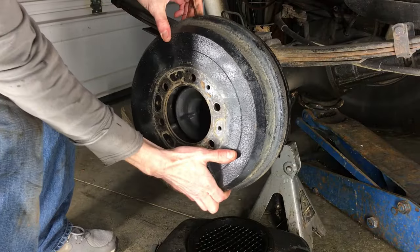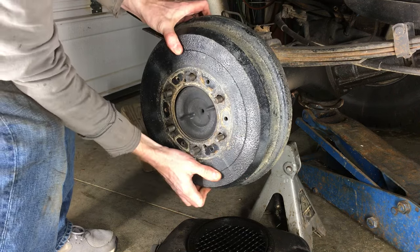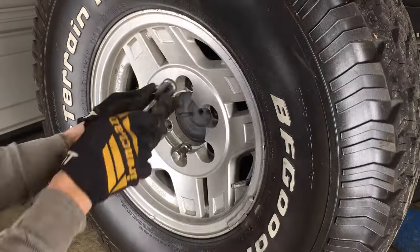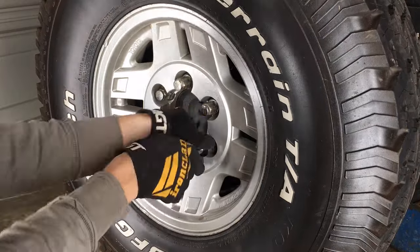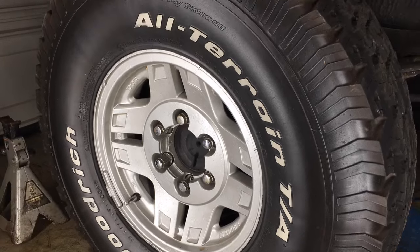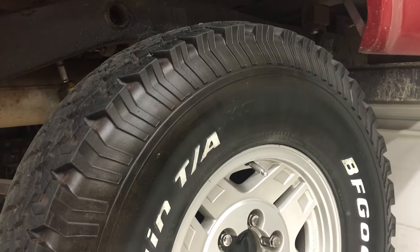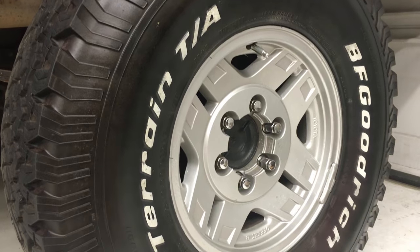Last thing to do before putting the wheel on is to install the drum cover. I painted this a while back with black caliper aerosol paint and although it's a little dirty at the moment, it looks a lot better than a rusty drum. Almost done. With the wheel on, I'm hand tightening the lugs before setting the truck back on the ground to tighten them with a torque wrench. I didn't bleed the brakes yet because I'm planning on replacing the master cylinder next; otherwise, the rear brakes will need bleeding after this job since the brake line was disconnected. And that's how I do this job without owning a press. If you have any questions or tips I missed, let me know in the comments below. Was this video helpful? If so, please give it a like. Subscribe for more tutorials and videos of my 1985 Toyota pickup here at the 6th Gear Garage.